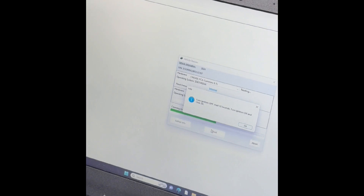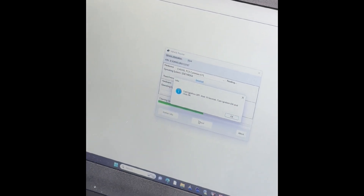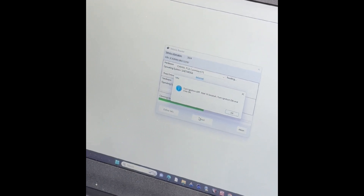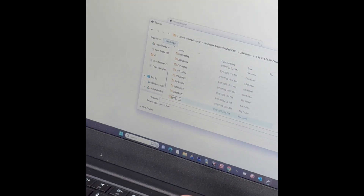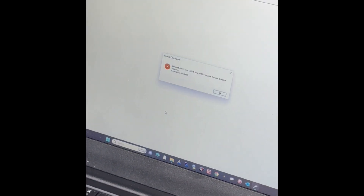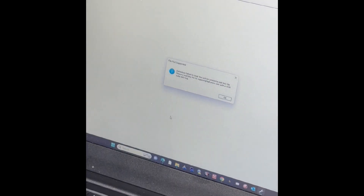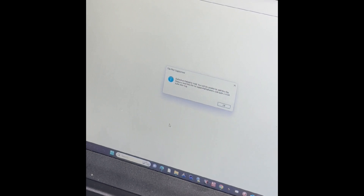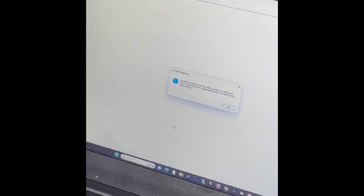Readout completed — that took right at about eight minutes. The screen says turn ignition off, wait 10 seconds, turn ignition on, and click OK. Turn ignition off, wait 10 seconds, then turn ignition back on and click OK. It says completed. So we're going to save this file wherever you'd like on your computer. I'm going to put it in our base files folder — this is going to be 24PU ASIN readout. An error popped up: validate checksum failed, you will be unable to save or flash this file. Another error will come up saying definition failed to load — please email this file to support at HP Tuners. It's perfectly OK when you get this. All it means is that this operating system is not yet supported. So send me the readout anyway and I'll take care of it from here.